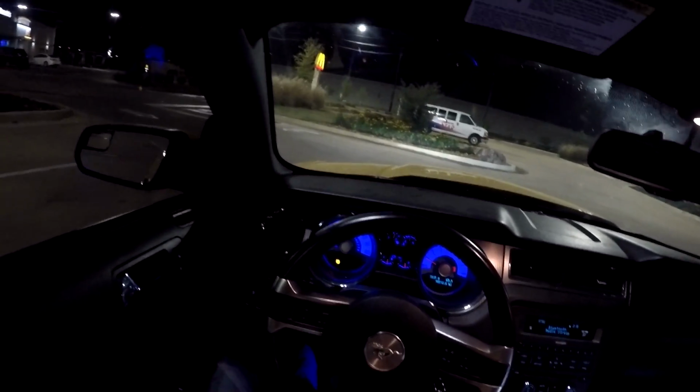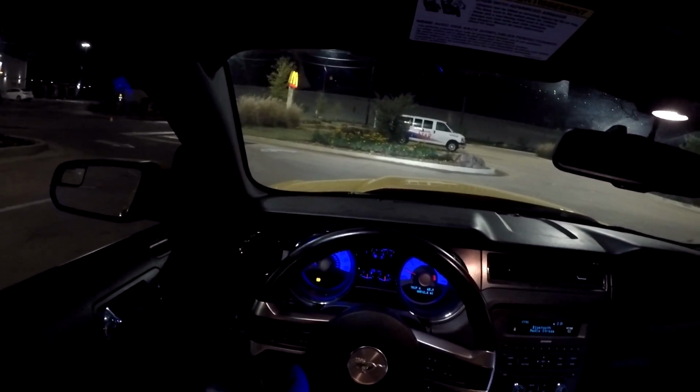I've just been driving the car, man. It's 2 a.m. I gotta break this car in. 2K is literally soon, man. I gotta break this motor in, and I wanna do at least 1,500 miles. I'm gonna do the oil change at 500-600 miles, and then at the very least 1,000, but I'm gonna try to get at least 1,500 before I really start ripping it.